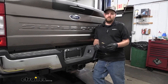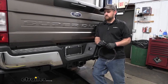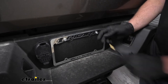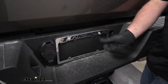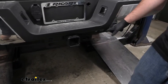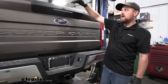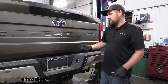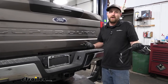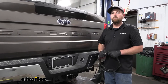Now that we have both bags in, we need to figure out where to mount our inflation valves so we can run our airlines over to them. In most cases, what I usually do is take out the license plate screws and plastic keepers and use our valves to come through and not only secure the license plate but allow you to air up the bags — it's a little more discreet but easy to get to. Or some people make a bracket of some sort around the hitch. Our customer today uses his truck to tow a fifth wheel camper, and since you can't really get in between that little opening with the trailer up, we're going to do something a little different. We can get creative and mount these wherever we'd like — we're actually going to mount our fittings behind the fuel cap.